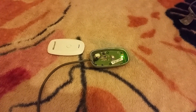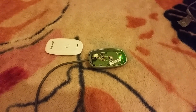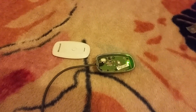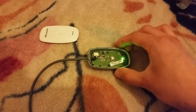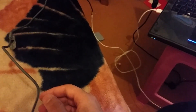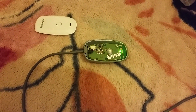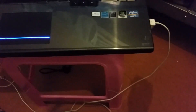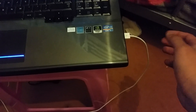As mentioned earlier, the issue could be one of two things causing this device not to power up or work at all. The first issue is something wrong on the board itself, and the second issue could be the cable — a power cut somewhere, or the USB end of the cable not working. My issue here was the USB end of the device being damaged, and therefore it wouldn't work.